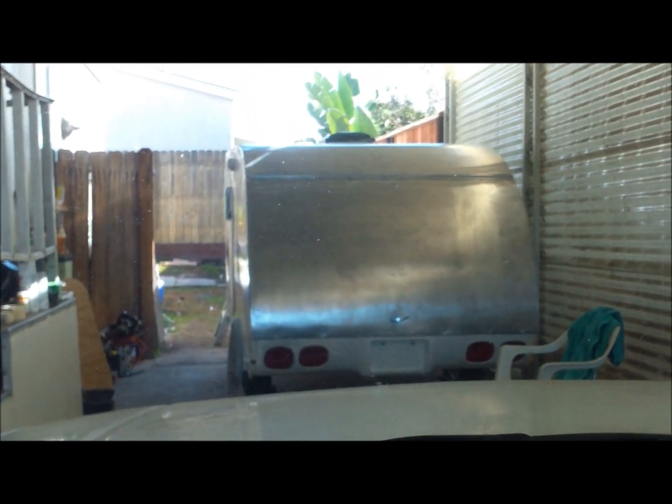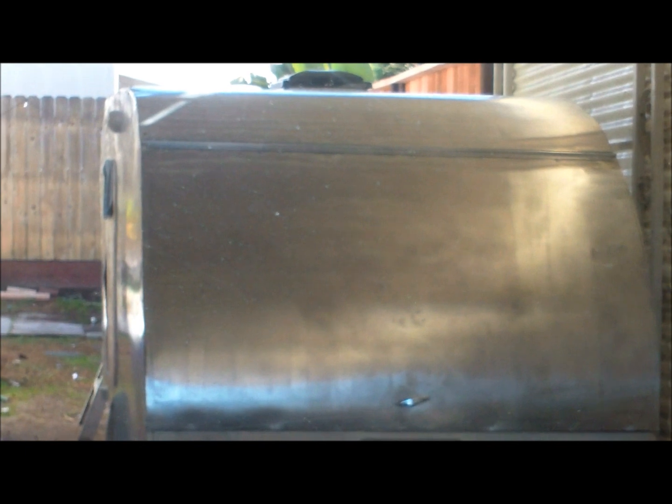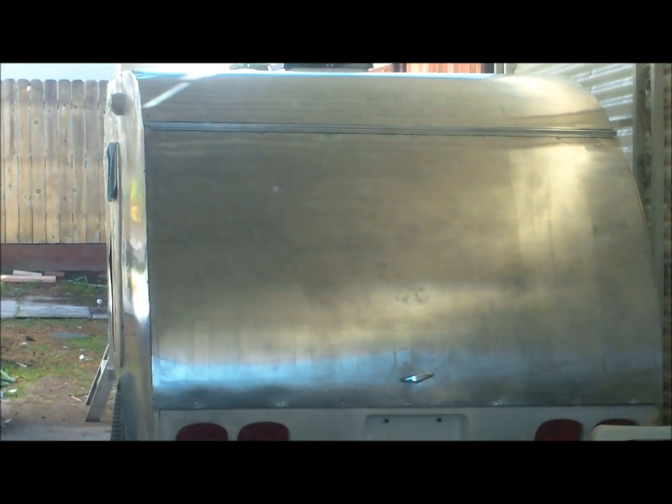I haven't done a video in a while. I haven't been detecting, been working on that thing the whole time. I figured out the taillights issue - it was a power issue with running both the taillights. I ordered some conversion bulbs for LEDs off of eBay, they came in and worked great, so now I don't have to cover the inner two back lights. Got the doors on, got the top skinned, starting to work on the galley a bit and a little bit on the interior.